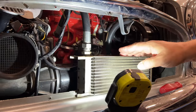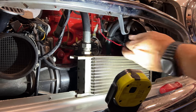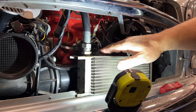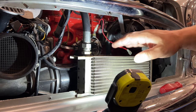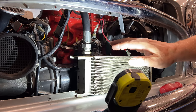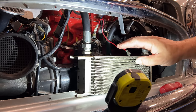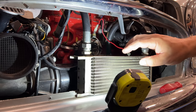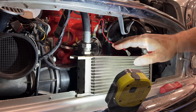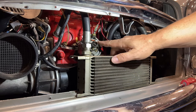This is a pretty easy conversion to do. You don't have to find top dead center. You just remove the wire that goes from the coil down to the distributor, and then you take the points out. The equipment for the Pertronix is keyed so that you can just stick it on there without having to set up the distributor, and your timing should be about where it was before. It's always a good idea to check it again afterwards. I will be taking out the points, which are right here, as well as the condenser.